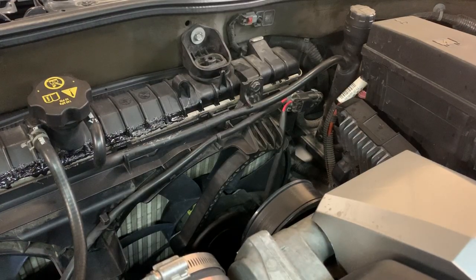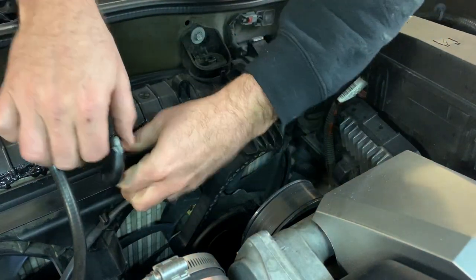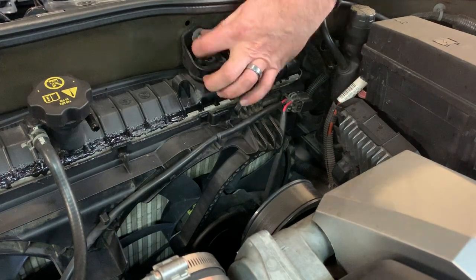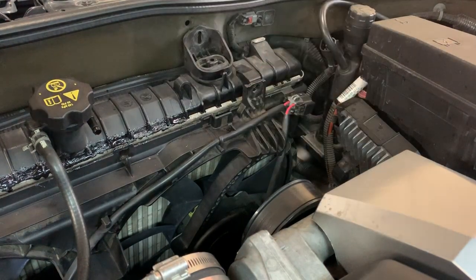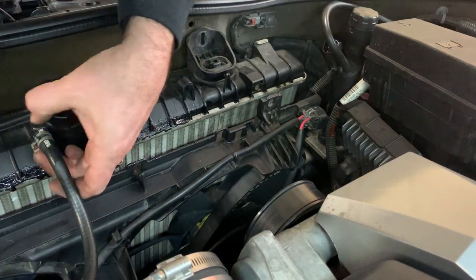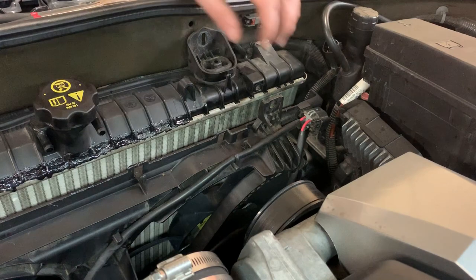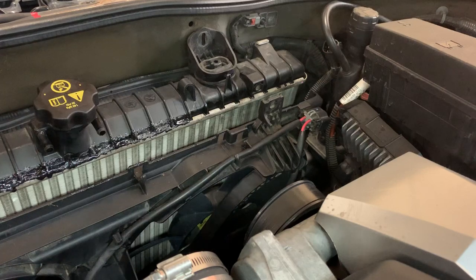While we've got that coolant draining, I'm going to go ahead and take apart some of this up top. Start with the hose, pull this out of the way. I'm going to wait to remove the fan — it's all unbolted now — until I get my coolant drained, because I don't want any debris falling in there.